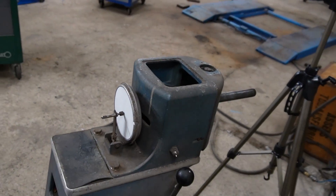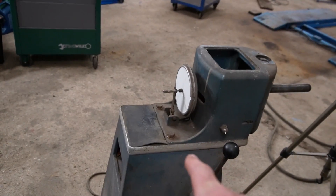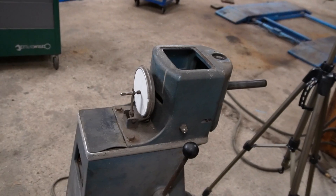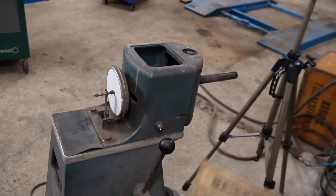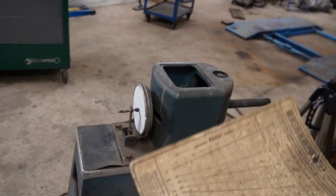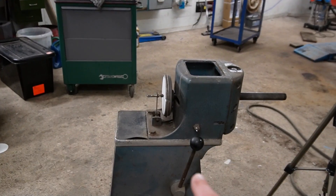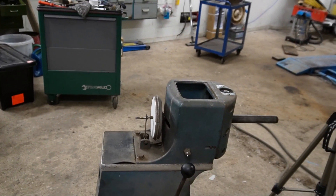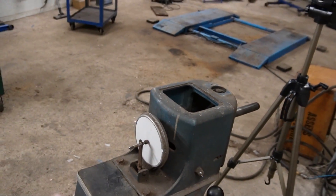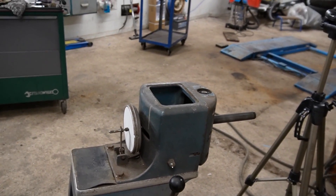By using this piece of paper and finding the correct size of rim — I'm not going to do a full balance today. What I want to do in the next video is to rebalance some wheels that have just been balanced by professionals. I'm getting four wheels with fresh new tires, freshly balanced, in a week's time, and then I'm going to test them on this machine. But what I want to do in this video is to see what happens if I don't have a wheel on it and just spin it up. I'm expecting it to make just a tiny dot with no imbalance shown. If it shows an imbalance without a wheel on it then something is wrong with the shaft or the bearings.